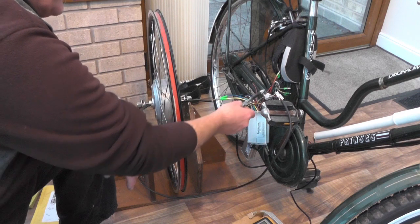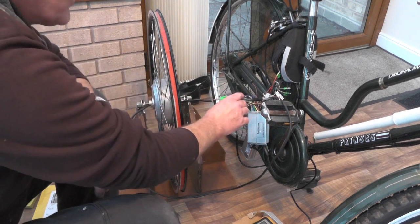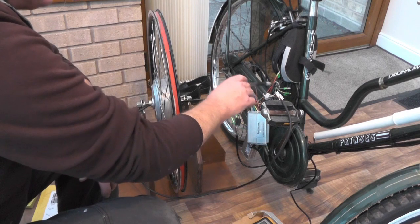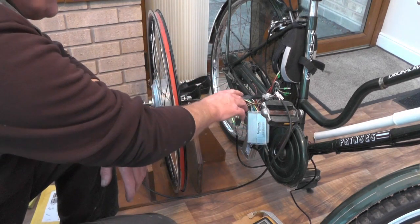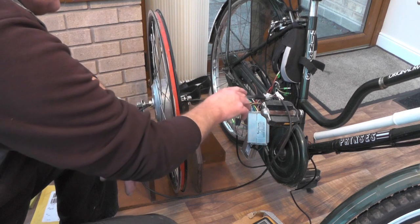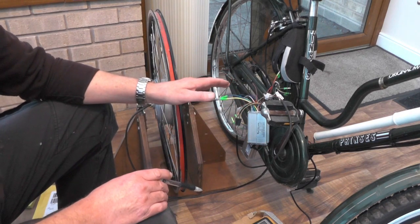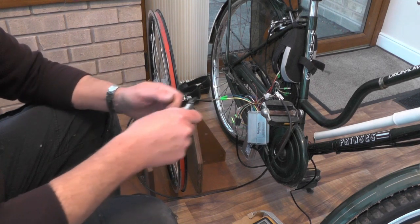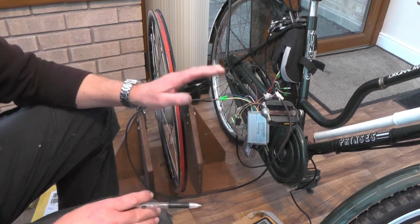I've got the hall sensors here into this six-way connector, though there are only five wires in it. I've had to push the wires in temporarily until I couple this up to a connecting block — I don't want to do that now because I want to cut the wire to a suitable length once I get it on my bike. So I've got red to red on the controller, black to black, blue to blue, yellow to yellow, green to green — standard colouring. You may have to alter those three wires — the blue, yellow, and green. Your positive and negative will always stay the same.